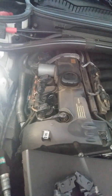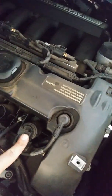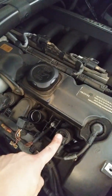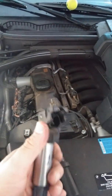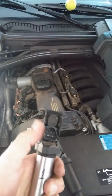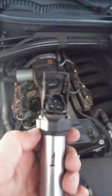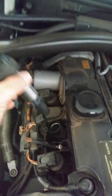The next thing was to take a look at the coil packs. The coil packs are these devices here and they go in here — these two right here. I pulled out the coil pack: you lift it up, pull out the connector — don't unscrew it, just pull it out — and then use some strength to pull the coil back out.